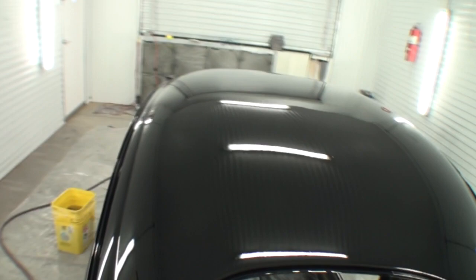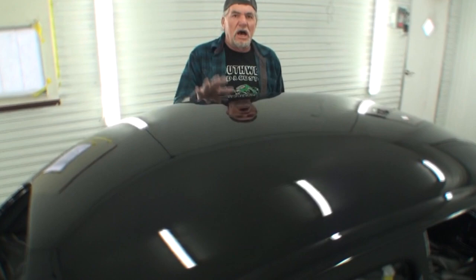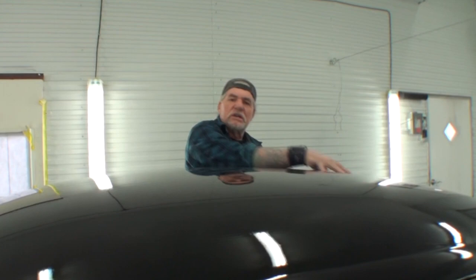And that's what's really important, because shrinkage on your clear coat is one of the possibilities why you have orange peel. You use the wrong hardener. You sprayed it too thick, this, that, and the other, and by the time all the reducers and the hardeners and the paint fumes evaporate, it shrinks down and causes an orange peel. But by using that inner coat clear, look how nice that is. Listen to my hand. Watch.